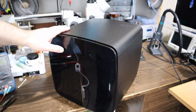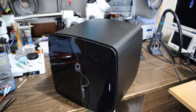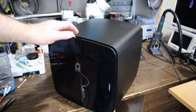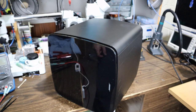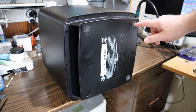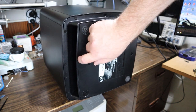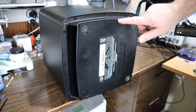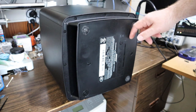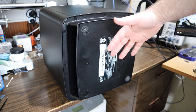It's got a wonderfully nice glass top. The sub is facing upward and the sound comes out around the edges - definitely no sub at the bottom - so it has to withstand vibration. I won't set it upside down on its glass just in case. There are screws around the outside and some under the rubber feet, so peel those off. There are little screws in the corners and it looks like a separate plate that may come off with the guts on it. I won't undo the bottom two unless I have to, because they could be holding the insides to the bottom plate.